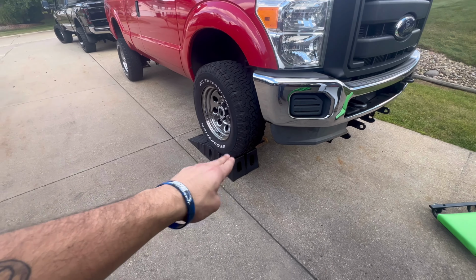So, lots of paper towels. Old diff cover in the box. Brake clean, your best friend. Some of you guys have seen me do this on the black, or the blue truck, I'm sorry, and I do this in all the gearboxes I do, but you want it nice and clean like that. Obviously not a dirty surface, get all the silicone off. I went over it with the razor blade. Brake clean everything, make sure it's a clean sealing surface, the mating surface for the RTV.